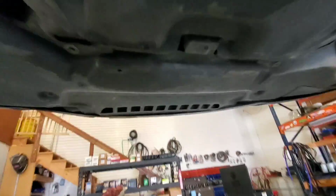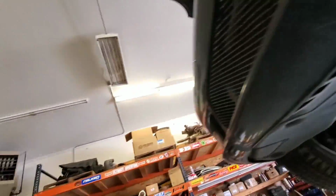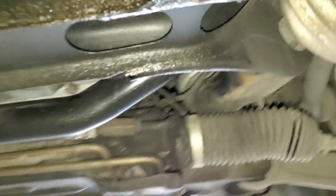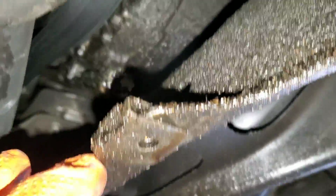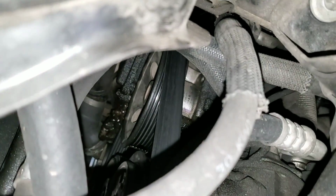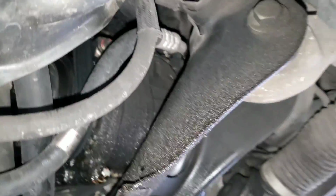And the thing is, I gotta do these oil cooler lines, but here, let me pull these plastics off and I'll show you. Alrighty boys, this is what it looks like underneath. Okay, it's nice and greasy. First glance, you think the AC pump is shot, which is that right there, but it's not. It's coming from up top, and if you could see it, it looks like the reservoir is leaking. Nope, that ain't it. Once we get up top, I'll show you.